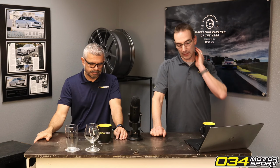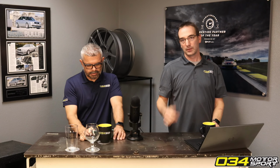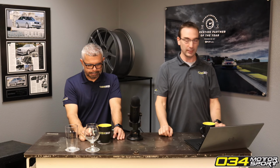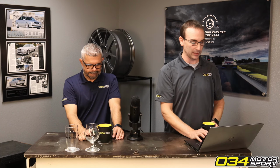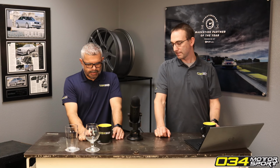Yeah, I wouldn't be surprised. I think a lot of that's just the exhaust sounding louder. Maybe. On the DASs, there is a power hit when they're shut, not just ECU-wise, but when they're physically shut. Do they open pretty quickly though? I'm saying if the valves are unplugged and they're shut, sure. Even if they're coded off, or if you run it in non-sport mode, everything quiet, you will take a power hit on spool up until they open up. All right.